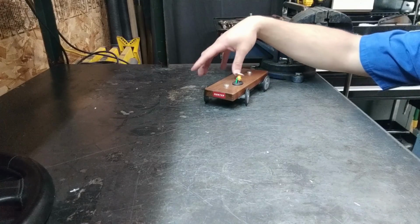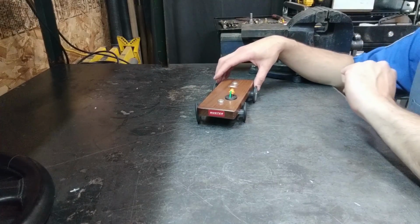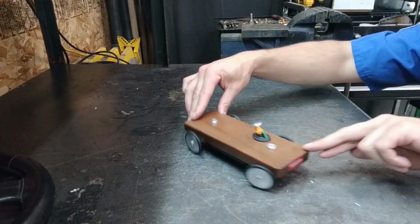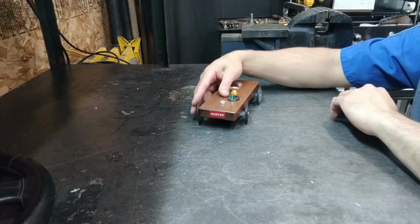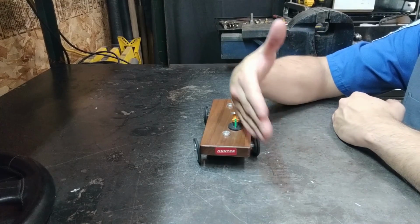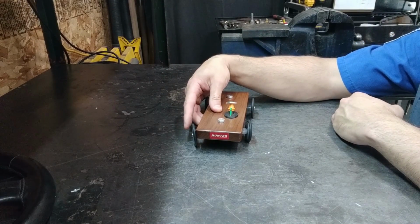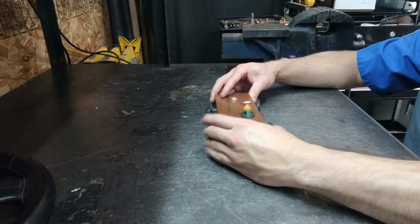the brakes on the outside are going to apply much like an ABS event where they isolate, reduce, reapply, and instead of allowing the vehicle to oversteer, by applying the outside brakes, it's going to pull the vehicle back into its intended direction of turn according to the driver's input. So that's the same for left turns as right turns.